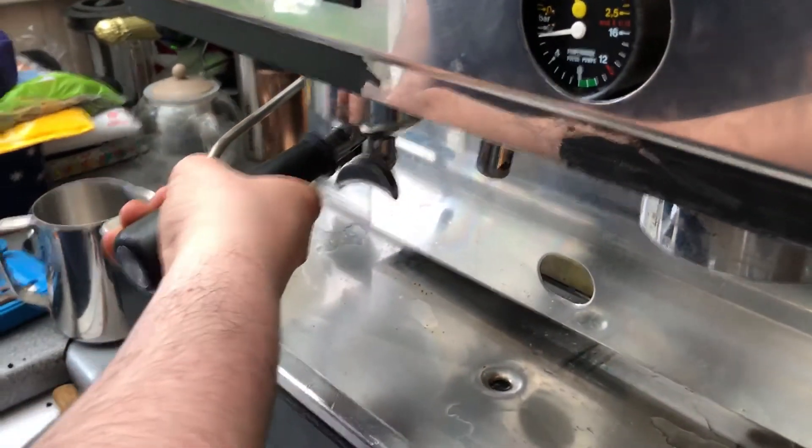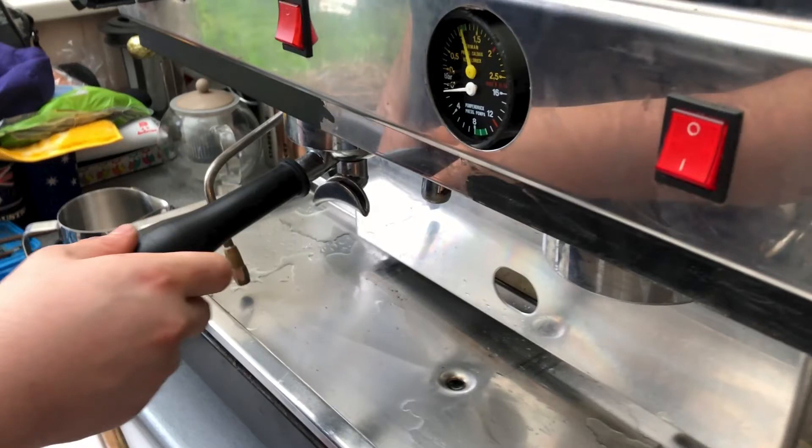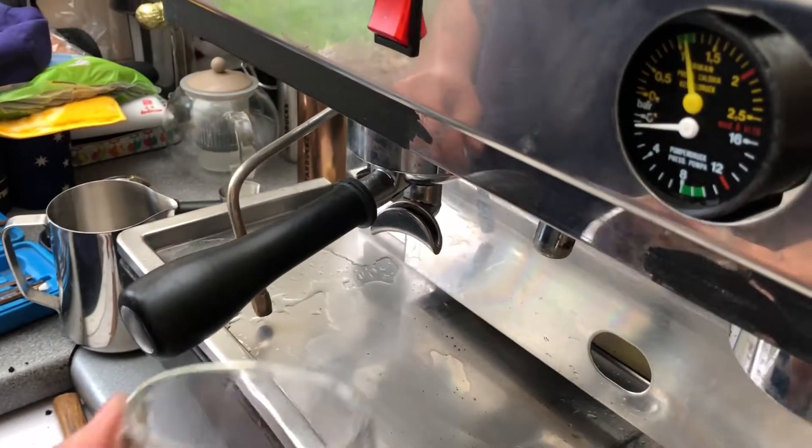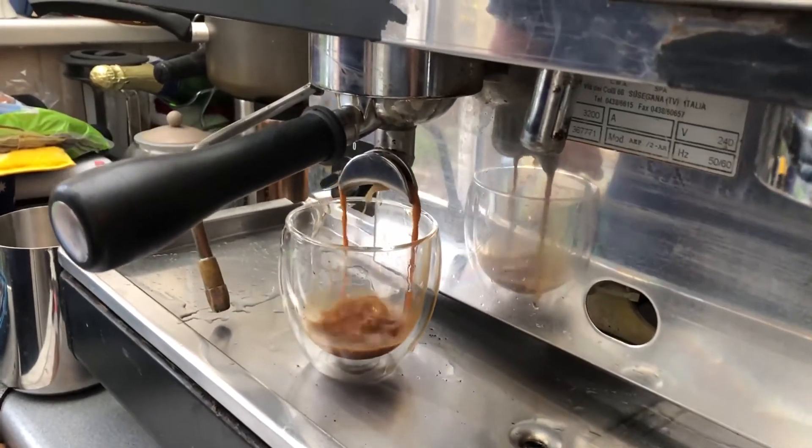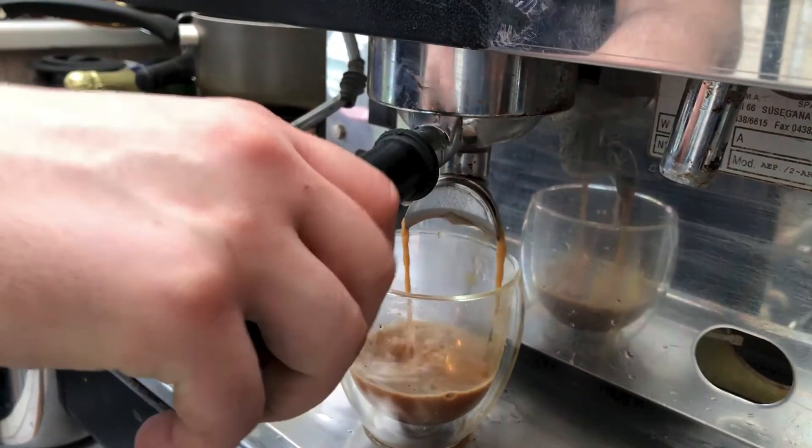This is a short snippet of some of the videos that I filmed whilst restoring it. So this is our first test. When you see here when we start this up, look at the state of that temperature thingamajig. Just everything was falling apart. Half the bodywork has fallen apart. It was just beat. But we thought we'd give it a test first. We didn't have a grinder. We didn't have a tamper. So we just threw some coffee grounds that we had into just one of the group heads there. And that's what happened. You could see straight away, once that was done, that the amount of water that was pissing out of that thing — the O-rings were shot, and the group head itself, just the whole thing was just done.